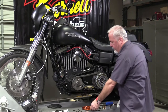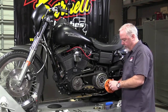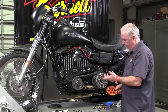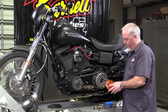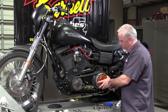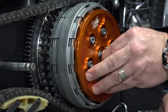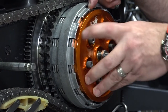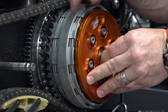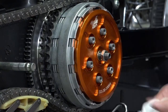Once your plates look good, put them back in and grab the new billet pressure plate. Thread the push rod adjuster in a little bit so it doesn't fall out, then put the pressure plate back in the same way you took the old one off. The standoffs come through the holes and the push rod adjuster goes down to the push rod — you'll feel it pop in. Wiggle it around and make sure it's all the way down against the plates with no gap, otherwise it won't work.